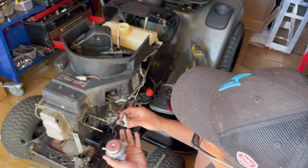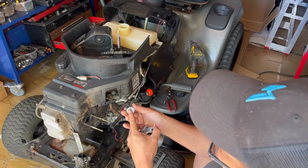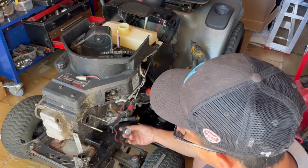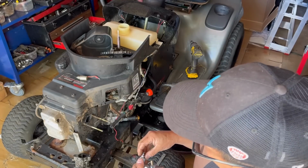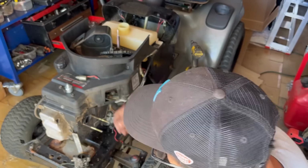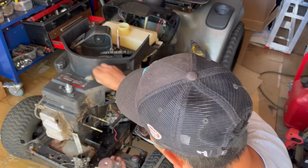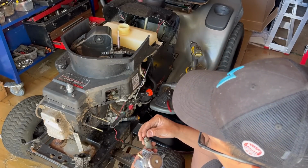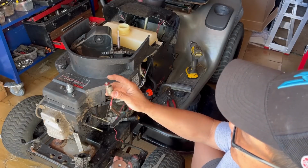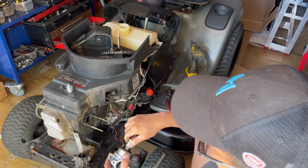I realize I'm modifying it because this one doesn't fit. The electrical output is a plug-in two-prong pigtail, right? And this one isn't. So you'd have to modify that anyway. It's just because this model tractor is different. This is a good fuel solenoid. I'm not going to use it. I never use it. I'm not even going to open this. I'm just going to trust that it's good. It's brand new. I'm going to replace the gasket there for the bowl. And it should go right on there.